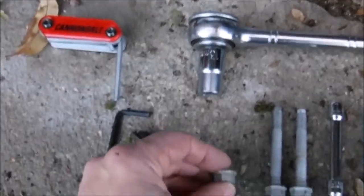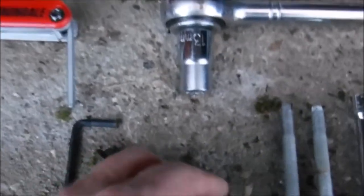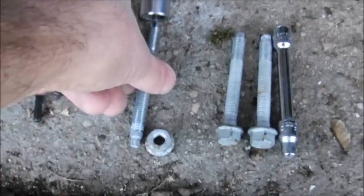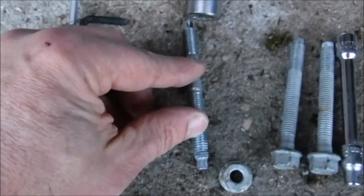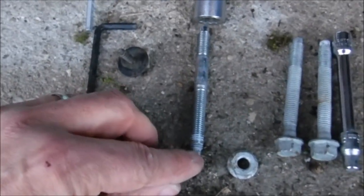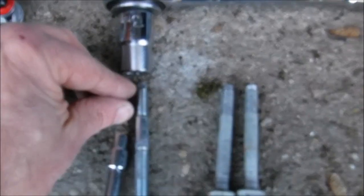Next, from the top, there's a 13 millimeter nut that goes into a stud into the block. You can loosen it, but there's about an inch that it can't clear. So what you need to do is take out the stud — it's a little stubborn at first, but it comes out using a 5 millimeter socket wrench. After you remove that, you've got about 5/8 of an inch of thread in the block.